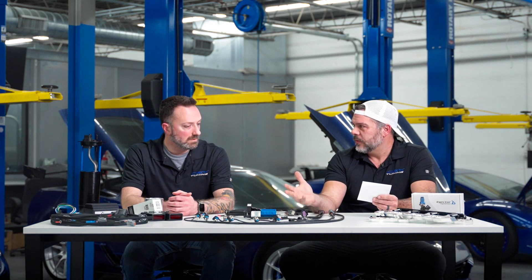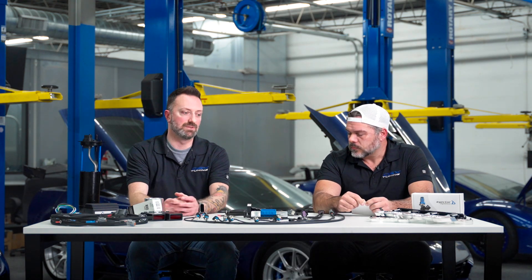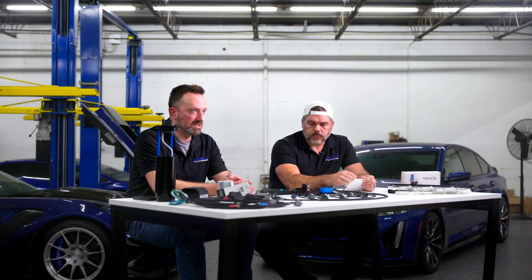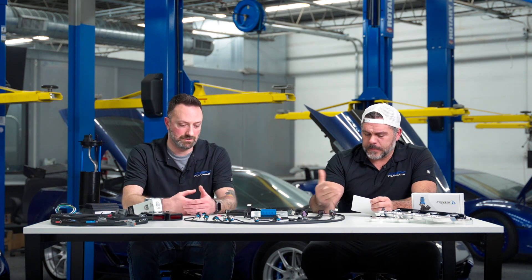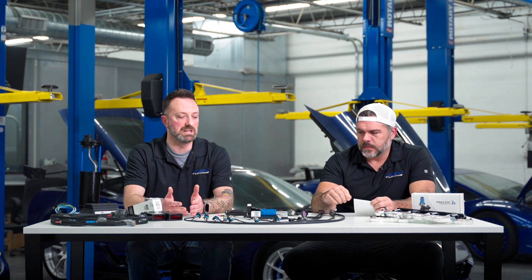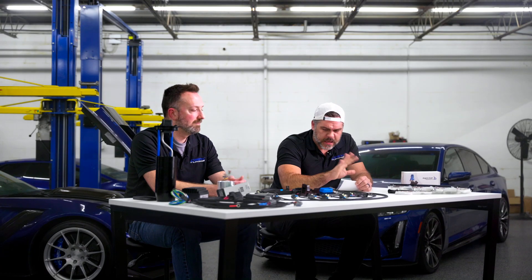Cost — for what else is out there, really affordable. For the Magnuson it's going to be notably cheaper just because there's a lot less to it. Making the linkage arm for the LT4 is kind of a pain, but we're targeting about five or six hundred dollars retail. The actuator is about half of that cost. This is a free update for anybody that owns the unit — it's built into the code, you're not going to have to unlock any part of the software or upgrade anything else. Your only effort is pinning the wires and connectors.